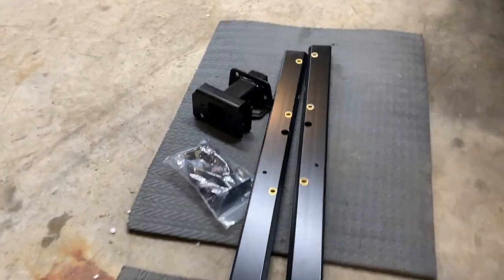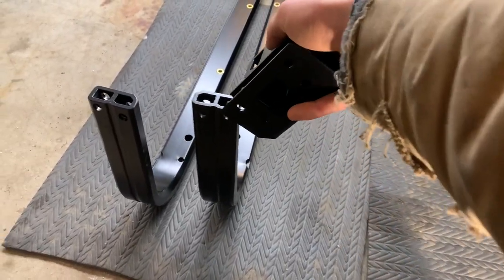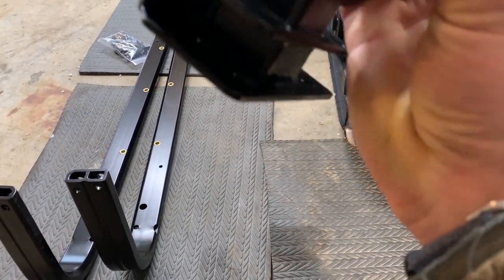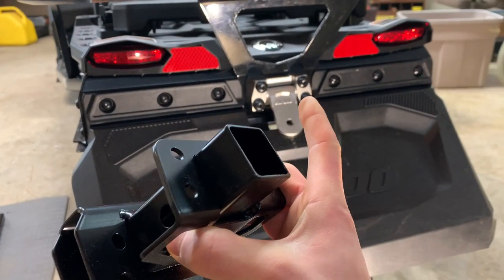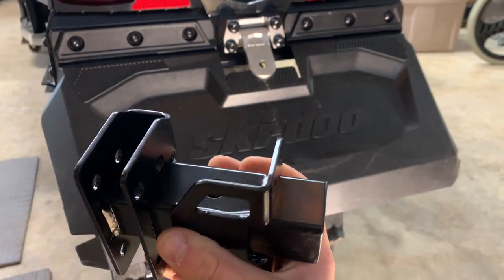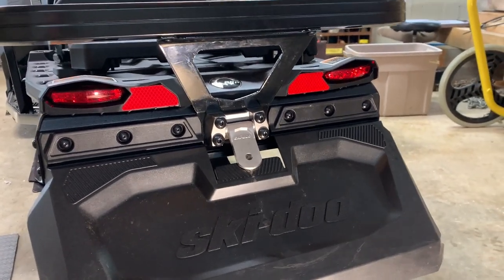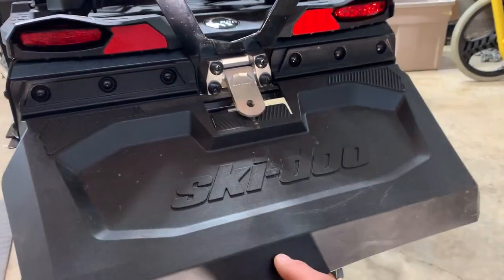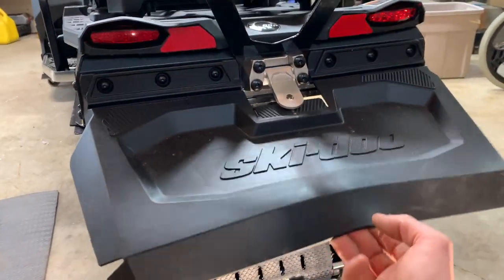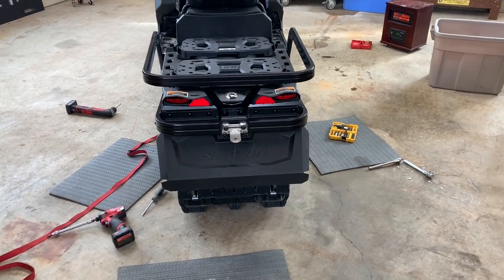This is going to make a bumper and you can see it gets bolted all the way down the side of the chassis. Here's where it sandwiches around and it gets all bolted and tied together. This is going to be left back here, and I don't know if I'll be able to flush mount that - it's going to force me to get their draw bar. It'll be heavier than just the tensile strength of the four bolts. It'll get it out further from the bumper too, which isn't great for tongue weight, but there's not really any tongue weight with a sleigh - it's just back there floating. It'll get you away from the snow flap. That's the heavy-duty bumper installed on the Scandic.